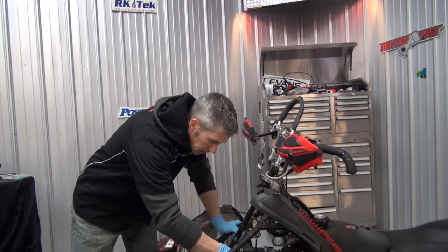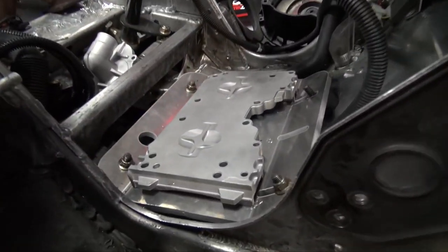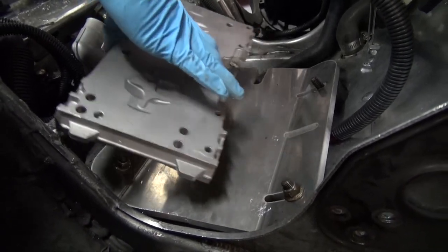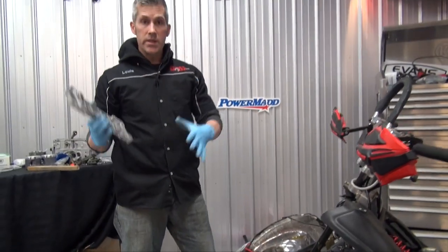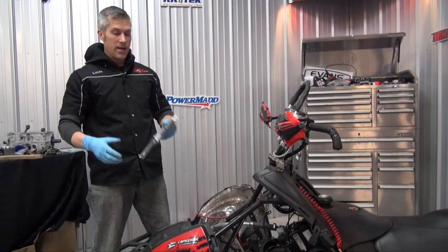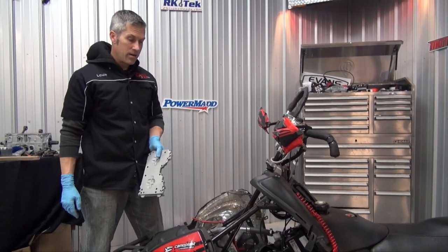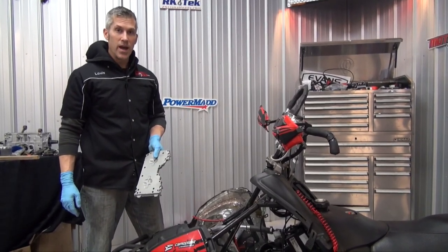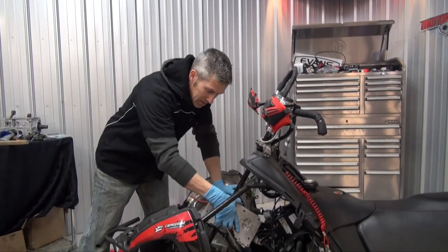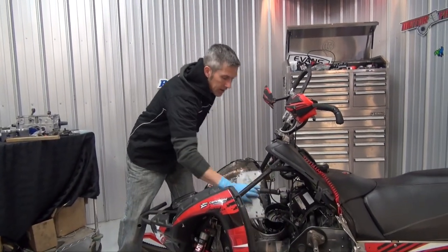We machined that flat and it's going to go on this engine plate right here — this is from Power Addiction Racing, Brad makes this. It's a generic plate, basically, so there are no holes in the bottom. What we need to do is put this engine together, line up the clutches, somehow try to mark the bottom of this base plate on that plate, figure out where these holes are, and then drill for the studs. My eyesight is a bit wonky but I think we'll be able to make it work.